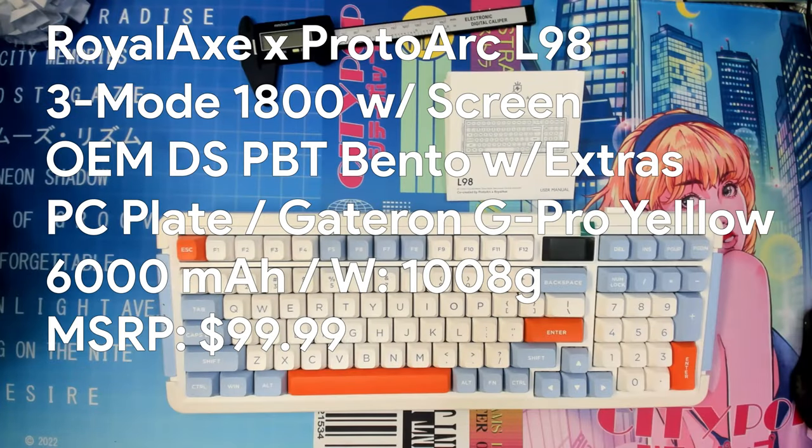Just the specs. Today we took a look at the RoyalAxe ProtoArc L98 in navy white. It is also available in a pebble white colorway. This is a 3-mode 1800 Bluetooth BLE and 2.4 gigahertz compatible keyboard. It comes with a programmable TFT LCD screen that also includes information about connectivity and battery percentage. It has a north-facing LED PCB with both 3 and 5 pin hot swap compatibility. It is preloaded with OEM double shot PBT Bento colorway keycaps, as well as some extras. It also includes Gateron G Pro yellow switches and a few extra in the box. This keyboard comes with a polycarbonate plate.